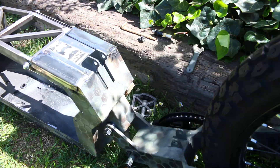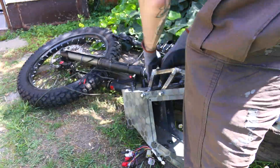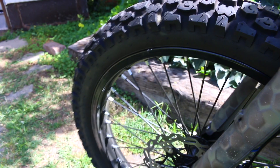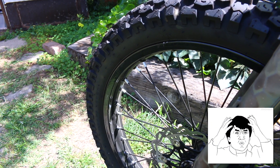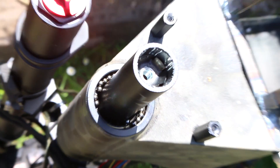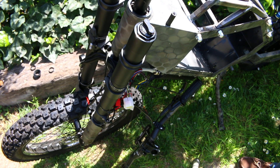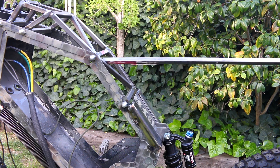I continued on with assembly and then ran into another big problem — when I went to put the steering tube into the frame, I ended up popping the top bearing and exploding it. You can see right here in slow-mo, part of the bearing explodes out the top and the ball bearings go everywhere. All the ball bearings started falling into the tube and then they were binding in there, and I had to use a sledgehammer and pound them out. So don't be like me — get some help or fasten your frame so that you can gently slide in the steering tube.